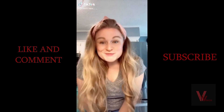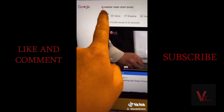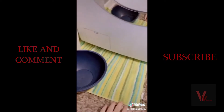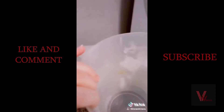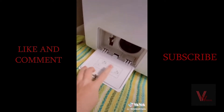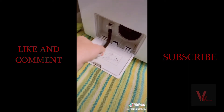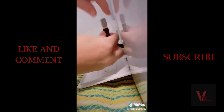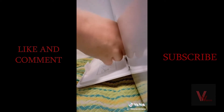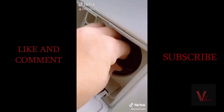Did you know you're supposed to drain and clean your washing machine every six weeks? Google search the type of washing machine you have and the three words 'clean drain pump.' Grab a towel, a bowl, and a large water pitcher. Open your pouch, pull out the drain hose as far as it'll go. Very carefully point it up, pull out the plug, and then drain it slowly into your bucket. Put it back, unscrew, and pull it out — you'll thank me later.